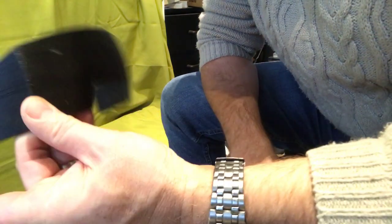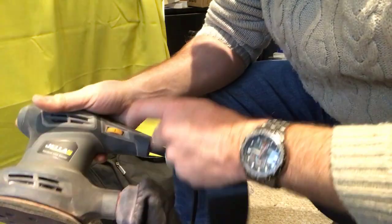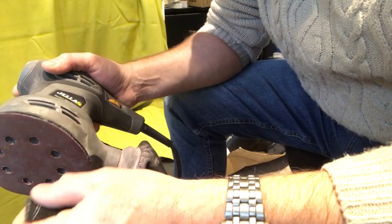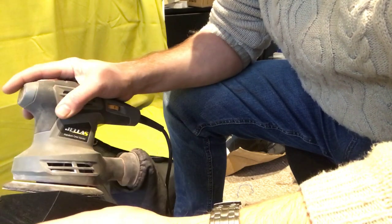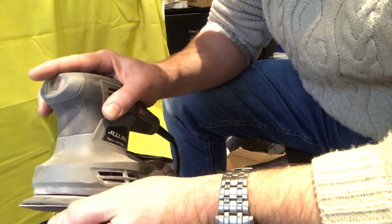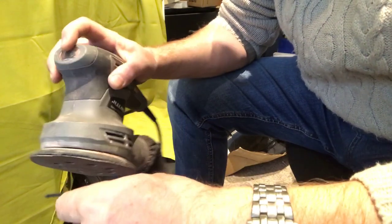The first thing I'm going to do is try and get rid of some of these striation lines and flatten that down. I'm going to use a little electric orbital sander turned all the way down to one, loaded with 120 grit sandpaper. Keep it moving all the time - that's a hint and tip. You don't have to press too hard. Go towards any feature lines but don't go over them, because you'll squash that feature out. Just go up to those lines to keep them - never go over the line or you'll radius it out.